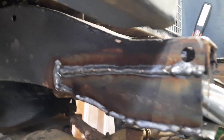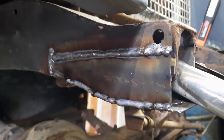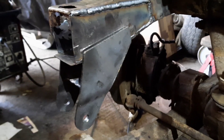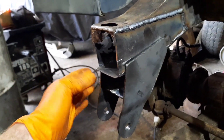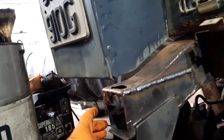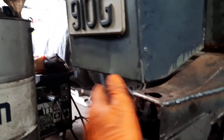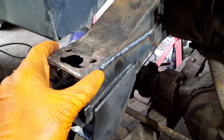Surface dressing with a flat wheel and a grinder just to tidy the weld up — that's looking alright. I've just aligned my spring hanger up, taken a few measurements off this one which is still the factory one, where it sits, and got it lined up where it needs to be on this side. I'm going to just tack that in place and then weld that up, weld an end on here, and then make a nice repair piece for this top — cut that out and fill that in as well.